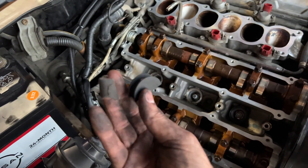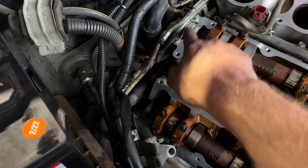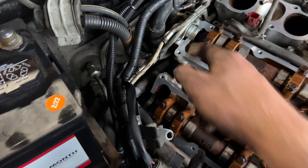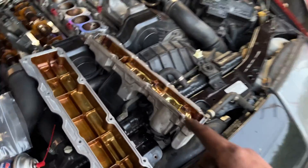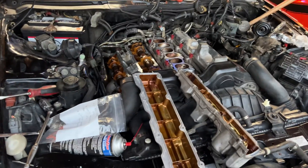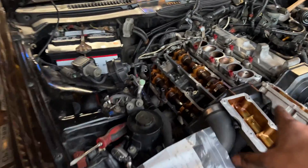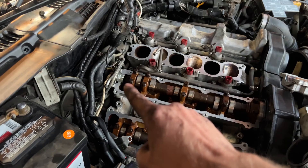I got to goop up this little plug and put it down right there. I did realize that these should be taken out so I went ahead and took those out as well and put RTV underneath to seal that up. Even on the rubber gasket I definitely put a little bit of that goop in the corners. I've done enough of these 90s Japanese cars to know that's the key to keeping these things sealed - put RTV in all of the little corners.